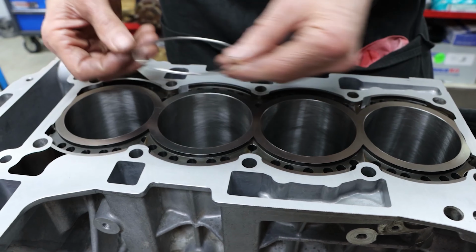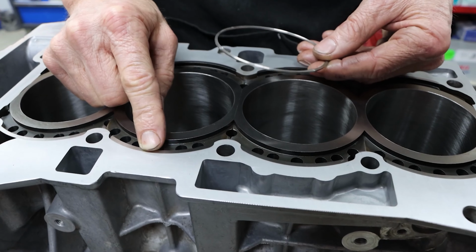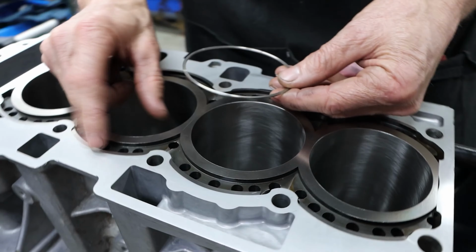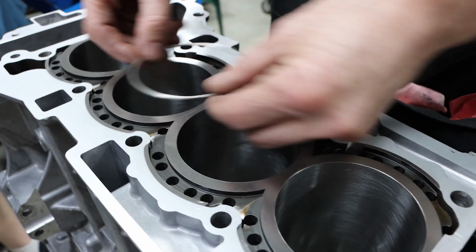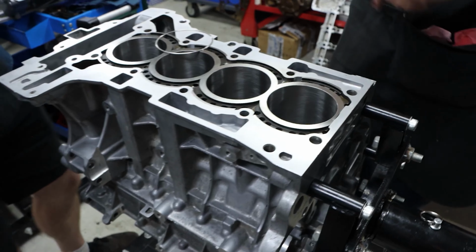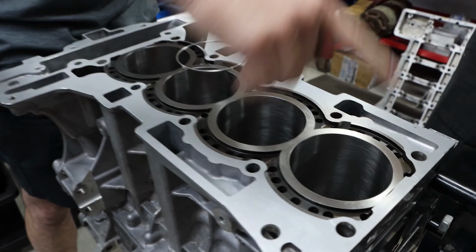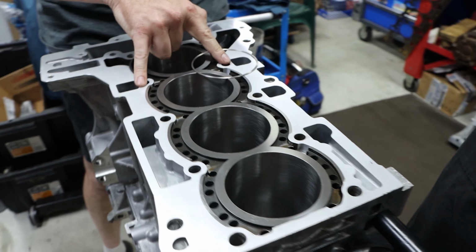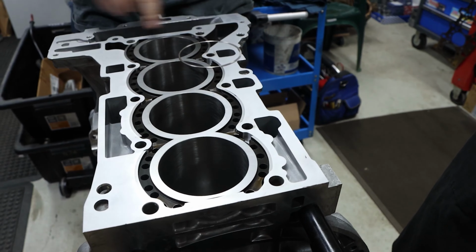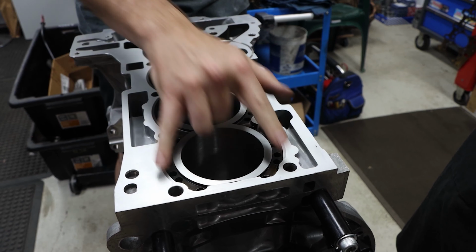And that fit is very precise, as I said, around here with the interference. So we've got to actually warm the block, and we cool the liners and get them in. And we think it's a pretty tight sort of a solution. Yeah, so this block has the 10 head bolts that normally go in. The middle 6 are an M11 size bolt, and the outer 4 are an M10. So we actually drill and tap these out to an M11 as well.